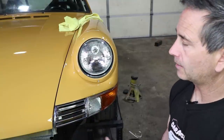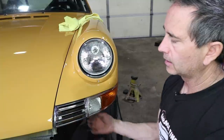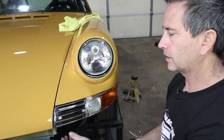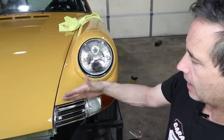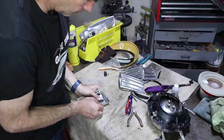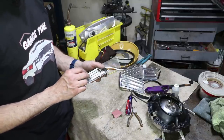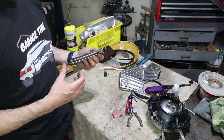The fit is not bad, although what happens is this needs to kind of tilt up a little bit to make it flush with the hood, and you can see how it rocks a little bit. That's where we need to get creative again and shim the bottom out. There's only two screws, so you can't really shim behind the screws and expect it to rotate. So this is where it needs to have something to stop it on the back, and then you don't want this to run into the chrome or the paint. I am going to create the space I need right here by adding JB Weld. JB Weld is like an epoxy and that's going to be the best way to space this out without really modifying any parts.